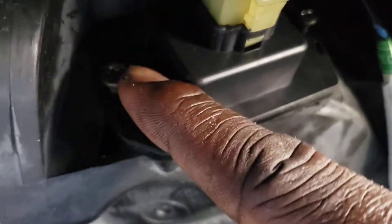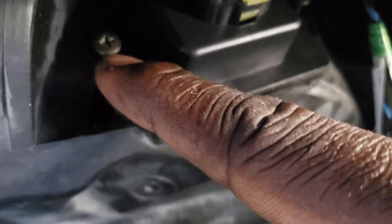In order to change it, the blower is right here and the blower resistor is right here. You can see the screws — I haven't finished putting them back on yet because I was making sure it was the resistor.